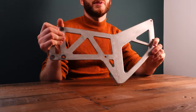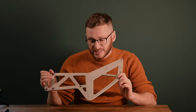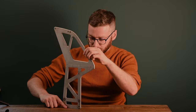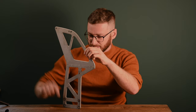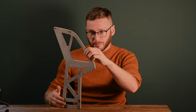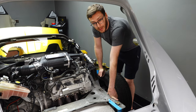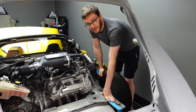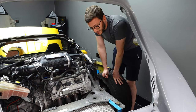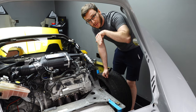What I have here is a Cup R wing upright and this was the basis of our design. If you see here, we have the bottom section and what that does is go through the actual clam and bolt into the subframe of the car at the bottom. I want a chassis-mounted wing so that means it's going to bolt into the subframe. The benefit of that is that the downforce is loaded direct onto the subframe, which means it's more effective — there's no loss in compression of the clam or anything like that. It is slightly more complicated than just bolting something onto the clam because I have to make it so that it all goes through the clam.